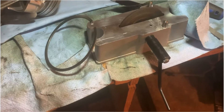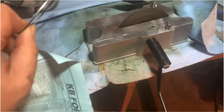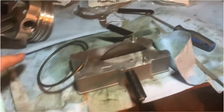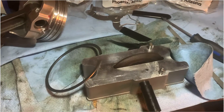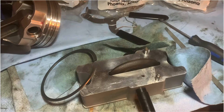Make sure you dress those edges with a little file after filing, so you don't get a burr. Also, if it sticks in the ring land it won't rotate either, so just make sure there's no rough edge after you've filed it. That's it — more tips coming as I assemble this engine.